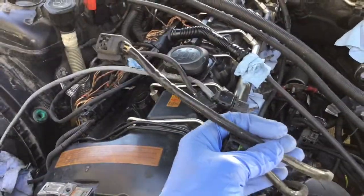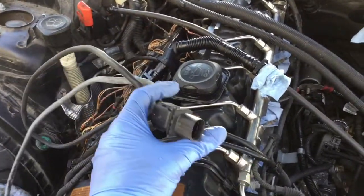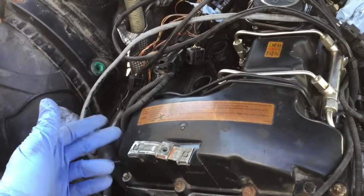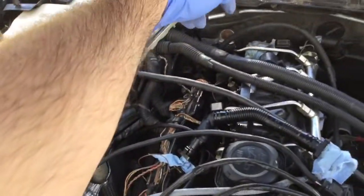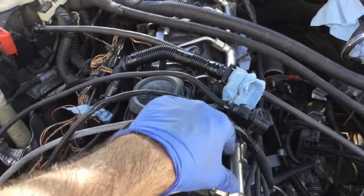These two here are the oxygen sensor connectors — they're gonna connect with the two oxygen sensor wires coming from down on the exhaust on the pre-catalysis. I can wait on those for now. I want to wait until I put the valve rack — I call it the vacuum valve here. There's a clip there to hold the wiring, so these wires are gonna go all the way to the back of the engine along here, clipping to the plastic clips on the fuel rail.